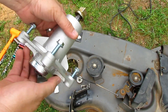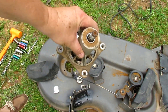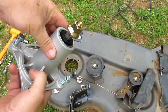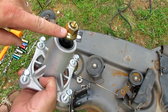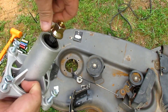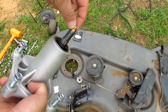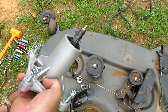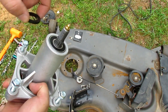You can buy these spindles as greasable or non-greasable. The ones that came off my deck have no grease fittings — nothing on the housing. I like the greasable ones because I want to be able to put grease in them; I think they'll probably last longer. You'll notice this one has a Zerk fitting right up here at the top of the spindle. So when I'm greasing the front end on the tractor, I can also shoot a squirt of grease into the spindle and probably increase its life.